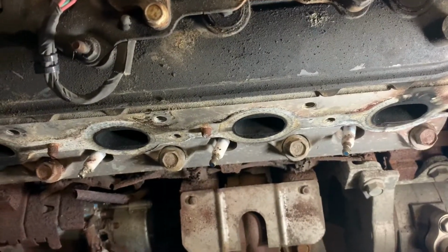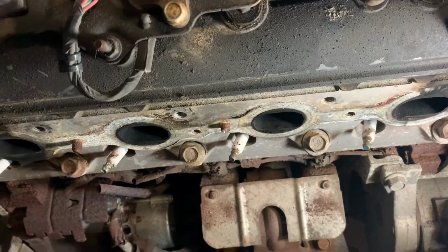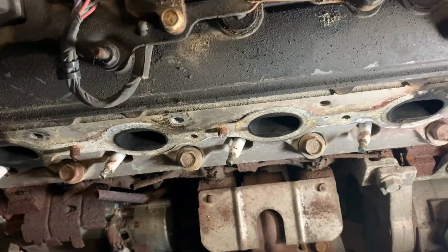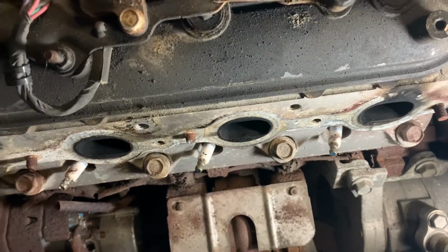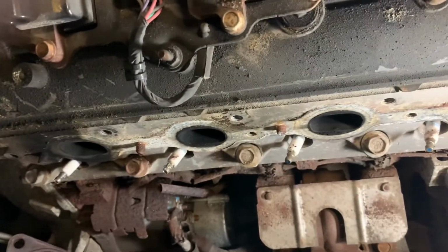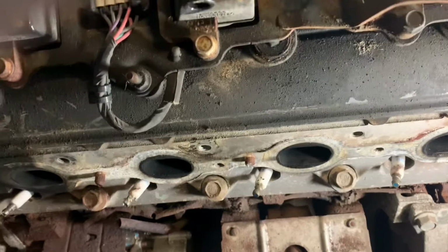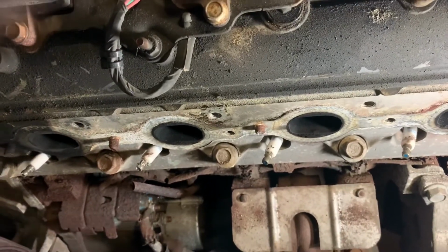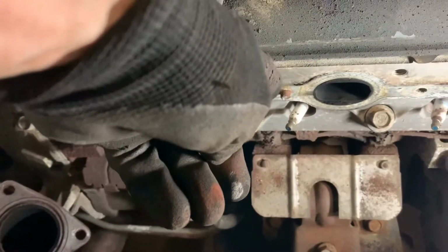All right, so here we are with the manifold off. Surprisingly, two of those three bolts that were still intact actually came out. One of them broke. So our final tally here is 4 broken bolts out of the 6 holding that manifold on. So what we're gonna do is take a grinder and we're gonna grind all the rust off of these